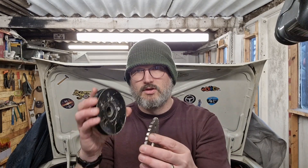What people would normally do is mount the trigger wheel to the pulley, and that's okay — it works. There are a few kits out there; I think Webcon do one which is actually quite expensive, about £180 all in. One thing I've noticed is the centre hole for the trigger wheel is quite small and you literally use the crank bolt to pin the two together. To me that seems open to slippage on the trigger wheel, which could end up throwing your timing out. You could bolt them together using the holes, but I don't like that idea because at some point they might come loose — and you don't want that happening at high revs.